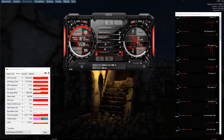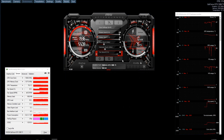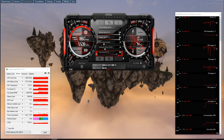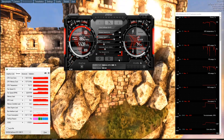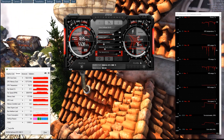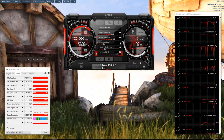This applies to everybody. A lot of times people say their card doesn't overclock very far — they got 25 MHz out of it. Well, if it's already running at 2 GHz and you apply 20 MHz to it, that's running at 2020 MHz, which is a very substantial overclock based on the original core clock running at around 1500 MHz and a default boost of 1630 MHz. That should wrap up the basics of overclocking as far as Boost 3.0 is concerned and how it affects your video card. Without understanding this part, it's hard to communicate the actual overclocking process — overclocking in any form is just adding on to whatever Boost 3.0 permits.